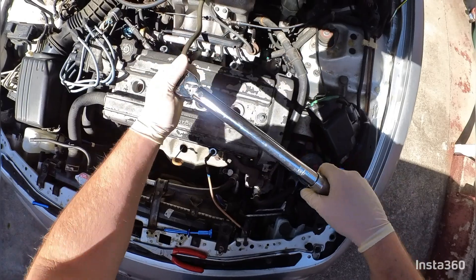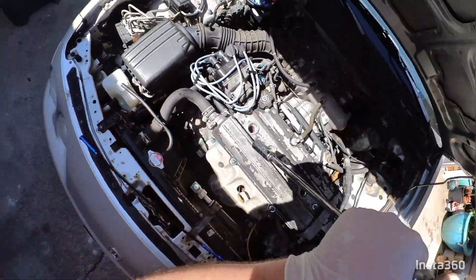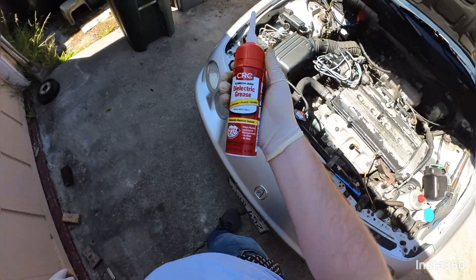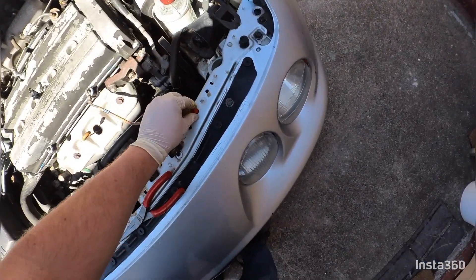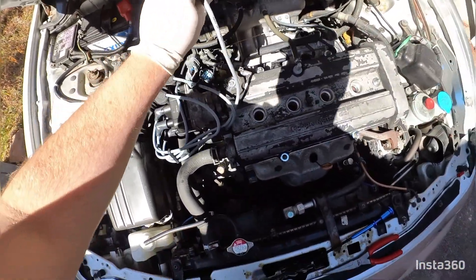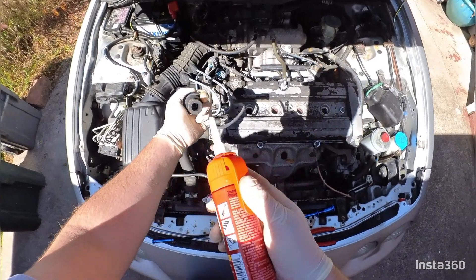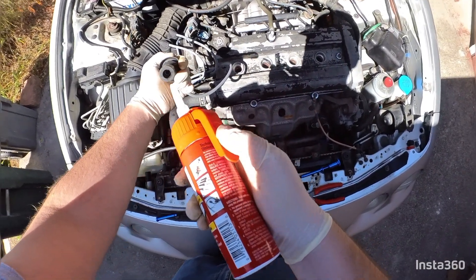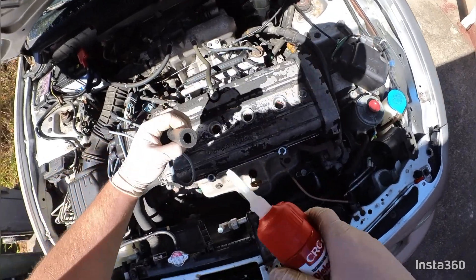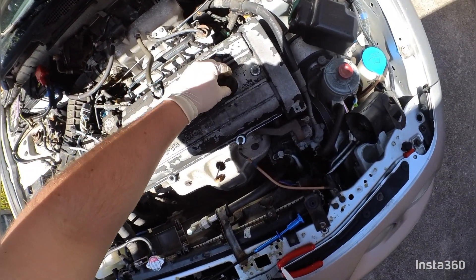It clicked immediately on all of them — those are probably a bit over-tightened. I'm also going to use some dielectric grease in the spark plug wires because I haven't used any before. One thing to keep in mind though: don't put too much in, especially with cheap wires. Too much dielectric grease can mess up the coil spring in there and it won't seat properly — it'll keep falling out. So be careful with cheap parts.